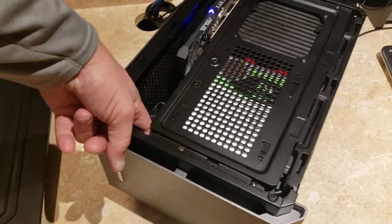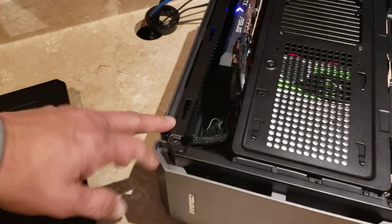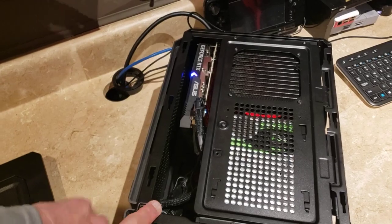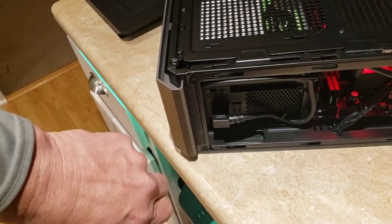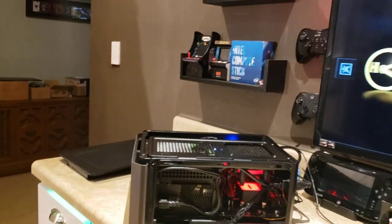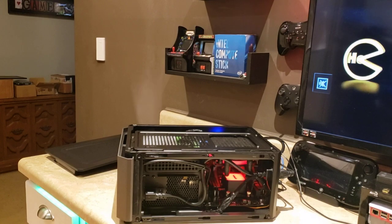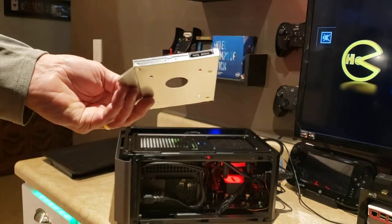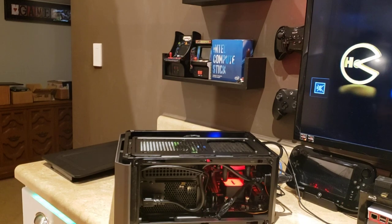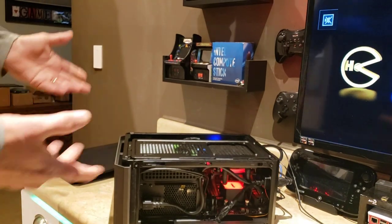I was going to add two more fans right behind this panel here, but there's so much open space. I did a really good job on this — it took me two hours. You've got additional two-and-a-half-inch drive bays under here and a little sneaky one right here. This spot is for a slot-loading optical drive, but with a seven-dollar adapter you can turn a slot-loading optical drive bay into a two-and-a-half-inch terabyte SSD. I have one laying around here. Bill's going to love this rig — actually if I had a use for it I wouldn't mind building one myself.